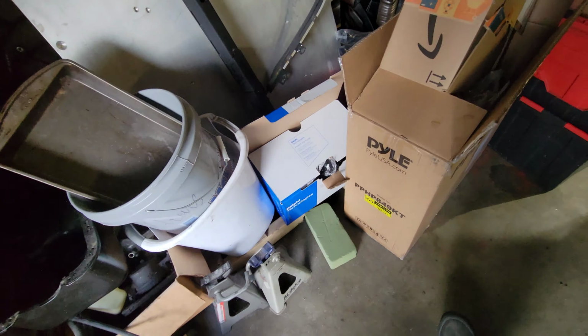I just wanted to quickly throw this on here. I took the old TPS sensor off the A6 that was cracked and broke, and I stripped it down to essentially this. Used the Dremel, just basically got the tube, and got far enough down that I could get the prongs out of there. To have this Molex already up, I'll go ahead and shrink wrap these on there, and then put them on there and see if I can pot them.